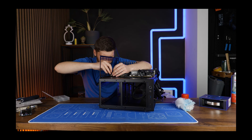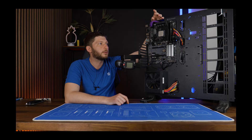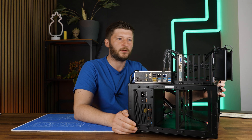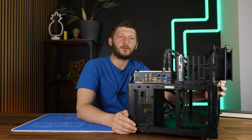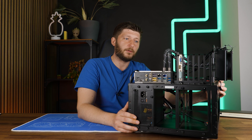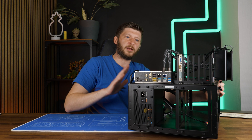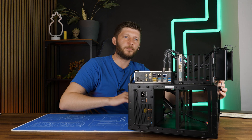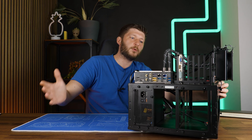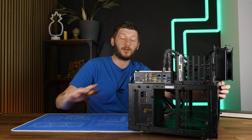We put the whole thing together, everything worked fine, everything was working exactly as expected. In the past I have used the 3900X as a benchmarking machine — that was a Ryzen 3000 — so everything was well known to me back then. I locked the V-Core at some point, I locked the core speeds, and then I blasted it and took it down to have like 135 watts at the beginning, going up as the CPU gets harder. Every CPU cooler I slapped on top had the exact same procedure — everything was standardized, normalized, I was fine.